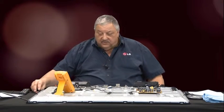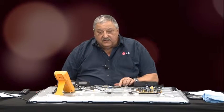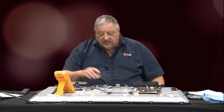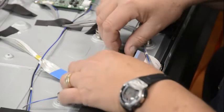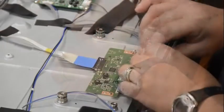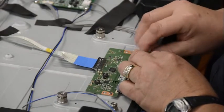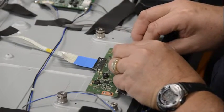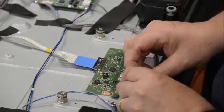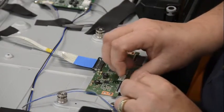So we have concluded that we have a defective T-Con board. Our step now would be to replace it — remove your two screws, remove the LVDS cable, replace the T-Con board. We put in the new one, reattaching our LVDS cable and our panel cables. Very important: take note of the alignment on these panel cables. If you get them slightly off-center, you'll get vertical lines in the picture and a distorted image, leading you to believe you have a defective T-Con board when the whole problem is misaligned cables.